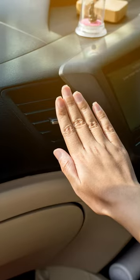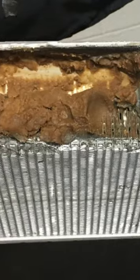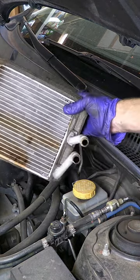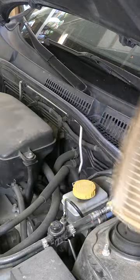If the heat in your car is not working, you may have a clogged up heater core, which is a small radiator inside the dash. The easiest way to check it is to compare the temperature of the heater hoses, the two hoses that go into the firewall.